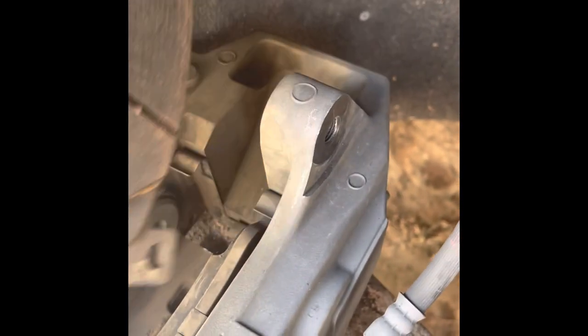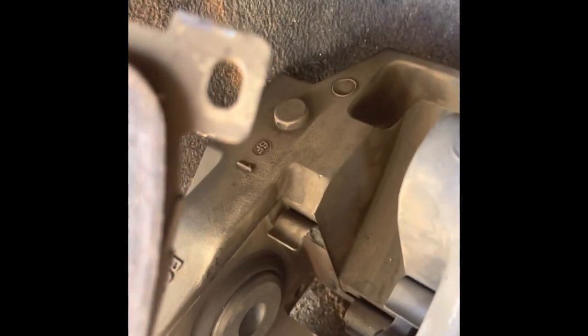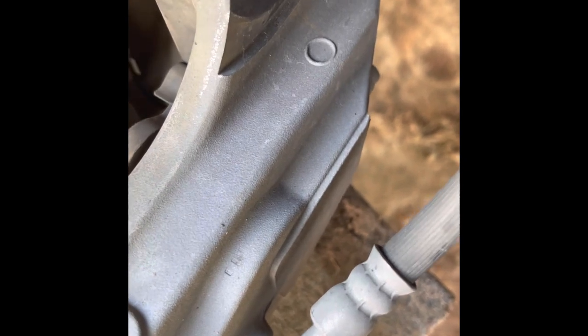I'm gonna finish showing you — this part of the brakes goes down. The ones like that you can pull out, or you can do it from the outside with that still on; it'll go down in there. When you put the new ones in, make sure they're facing this way, facing each other. The pads are facing each other, to the back of the pistons. Make sure you put them down in — like you see those parts right there, put them down in there and it should be good.